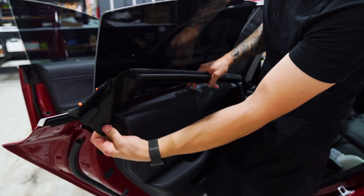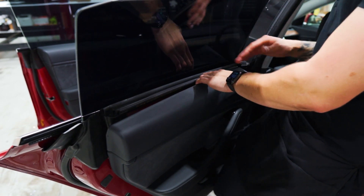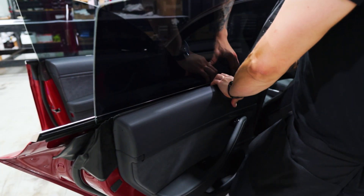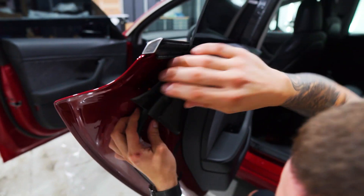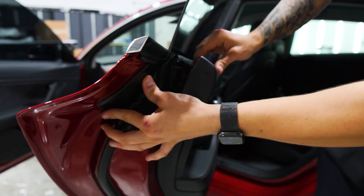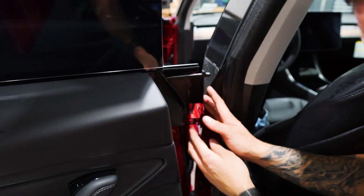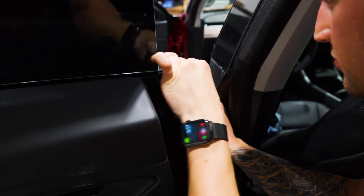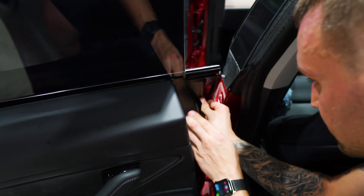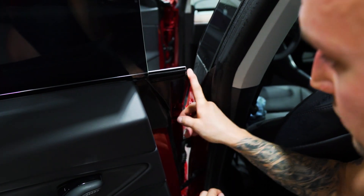The rear gasket is a little trickier. Slide the back part of the rubber plastic assembly in first, then do the front part. Once you have both rubbers behind the door panel, line it up onto the metal part of the door and push it into place, making sure it's centered. Start with the back — wrap around the weather molding, and once wrapped you'll be lined up with the holes. Push the pins in, push the bottom one that's behind the door panel in, then come around to the other side — same exact thing: wrap around the weather stripping, line up the holes. There shouldn't be much forcing because they're supposed to line up perfectly. The last piece is the little tab that goes onto the metal part of the door.